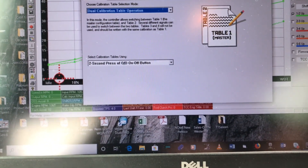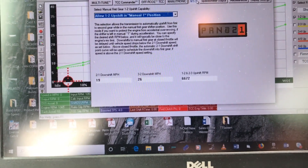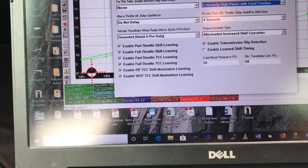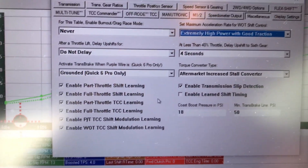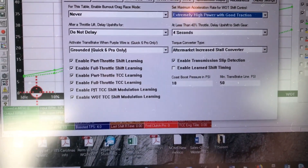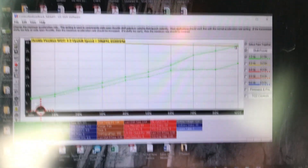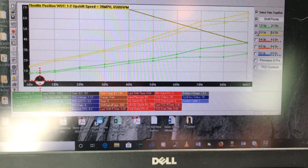Under multi-tune speedometer, this out here is for the trans brake. When you finish here, go back here — these are where you adjust your shift points. You basically drag it, and this is where I've got 6500. For different ones, as you select it you go here, and you save 6500.